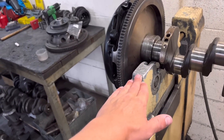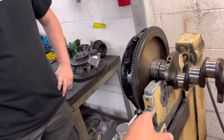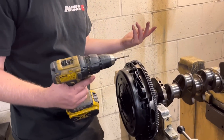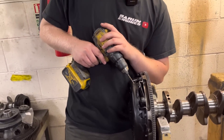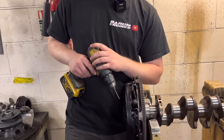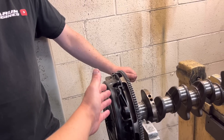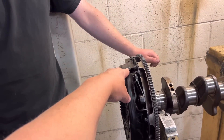Basically when you set it here on the angle, you've got to remove material off this plane right in it — or you can add material the other way, but obviously it's a lot easier to remove material if you can. Once you're marked up you can basically just drill a hole. There's no set amount — you sort of get to know the machine. It all depends on the diameter and the material; if you've got 40 out on a clutch, which is a big diameter steel, you're going to take less material off.